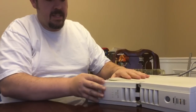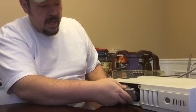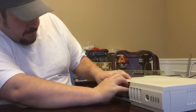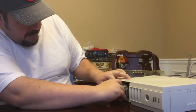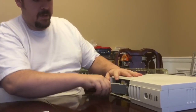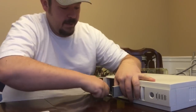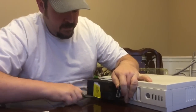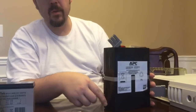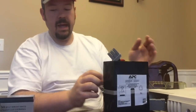The first thing you do is turn it on its side and pull this bottom part out — it just slides out. This is the piece here that will disconnect, so we're going to disconnect that from the wire. This part stays in and will help us pull the battery out. We have it out of the container now, and part of the reason it was hard to get out is because it's begun to swell, which is never a good thing — so it's good that we got it out when we did.